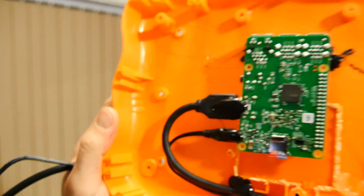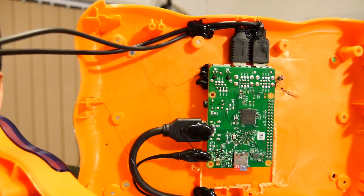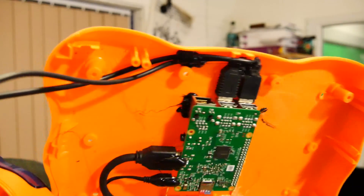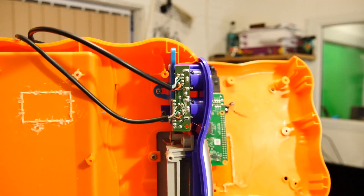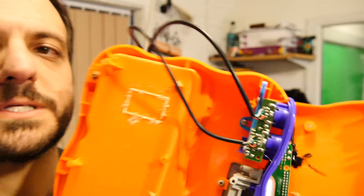So now let's get the USB on it and see how it goes. The Raspberry Pi is mounted, and you can see now at the top two new USB ports that have been hot glued in. I removed some of the strain relief so they could bend around at that angle. They've been wired in now to the actual ports on the front of the unit, and I've done the same to the joystick. So all that's left now is to wrap it all up, put in the screws, and plug it in.